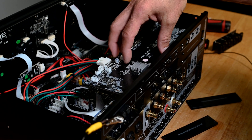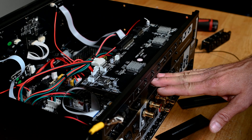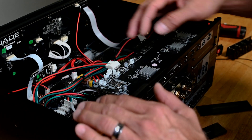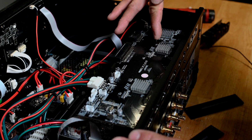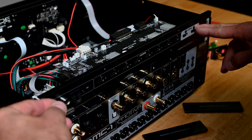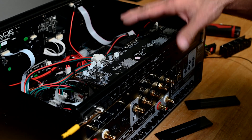If you would like to remove the HDMI board, it will give you greater access for installing the middle expansion module, though you don't have to. It's just if you want a little more room. That would be to remove all three screws in the top of the HDMI board and all 10 screws along the back. We will provide a video link below for removing and reinstalling that board.